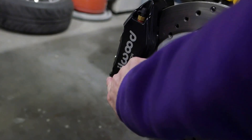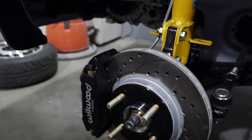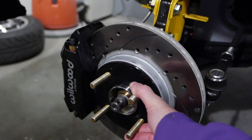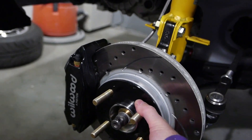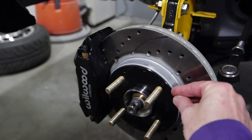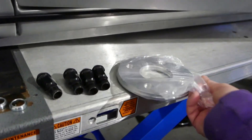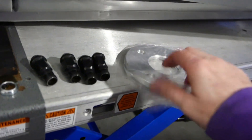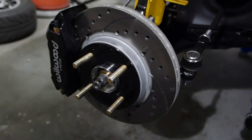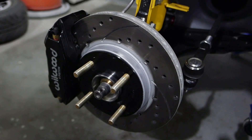I'm getting a tiny bit of a mark on the edges here because when I'm aggressively cornering — and by the way, I didn't have the wheel lugs torqued down fully, which is bad, but they weren't finger tight either, just not fully cranked. There's a bit of wheel flex and probably only a millimeter gap. So I'm going to take off these 3 millimeter spacers and put 5 millimeter ones on, which will move the wheel out 2 millimeters and give me just a bit more space. It shouldn't push the wheel too far out of the body.